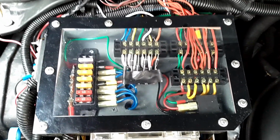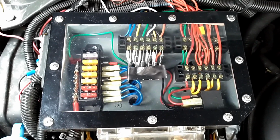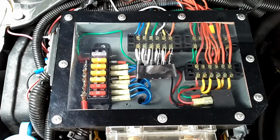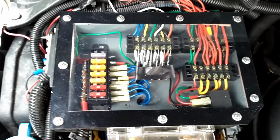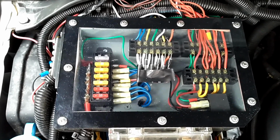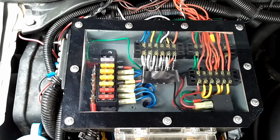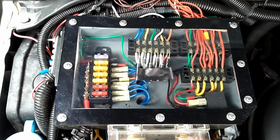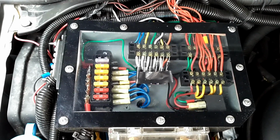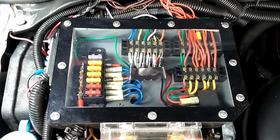And as promised, here is the end result. I think it came out very, very nice. As I had shown in the video earlier, basically I just taped off the center section, scuffed all the way around the edge of the plastic. I laid down 2 coats of Krylon gloss black. This is the type which is color and primer in one, and it's rated for a whole variety of materials including plastics, and I think it's really cleaned up the look a lot. You can still see a little bit of the edge of the weather stripping showing past the black, but overall I'm very happy with the end result, and it definitely meets the project goal that I had in my head as I was seeing it and visualized and now been able to realize.